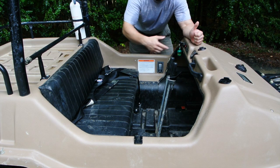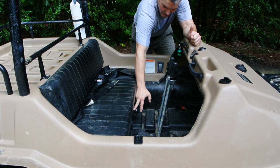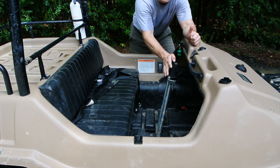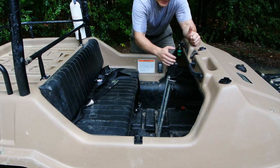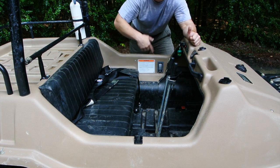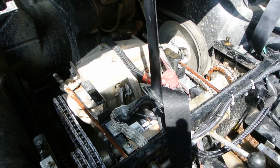The cockpit simply has a couple of gauges, a choke, and a shift lever for the transmission. You control it with these two control levers, one for each side of the transmission. Now, though you can't counter-rotate like in a tank, you can lock down one side completely, allowing you to turn in about the width of 2 body widths of the vehicle. This makes it much more maneuverable than any four-wheeler could hope to be.